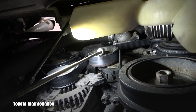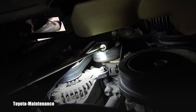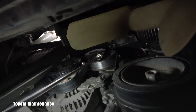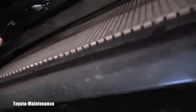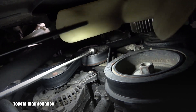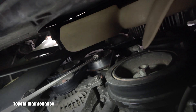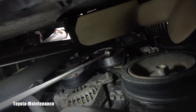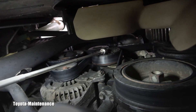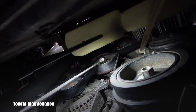You can see the pulley of the belt tensioner. How do I know it's squeaking? I carefully sprayed a little bit of lubricant on it and the squeak was immediately gone — in half a second or less it went absolutely quiet. But as the pulley rotates, the lubricant was moved away and it started squeaking again within about one minute, just as you heard when I was running the engine.